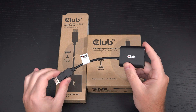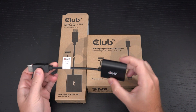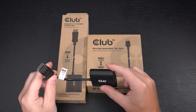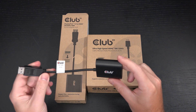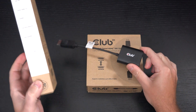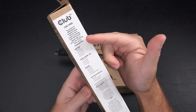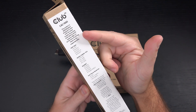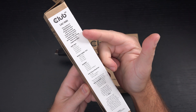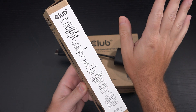Connect that HDMI cable to your television or monitor that supports HDMI 2.1, and you can deliver a 4K 120Hz HDR 12-bit RGB signal. Now if you're saying that's impossible — DisplayPort 1.4 can't carry that sort of bandwidth — you've missed some important information. It stated right on the side: your GPU must support DSC 1.2. If it does, you're in business. If it doesn't, you're out of business. That simple.